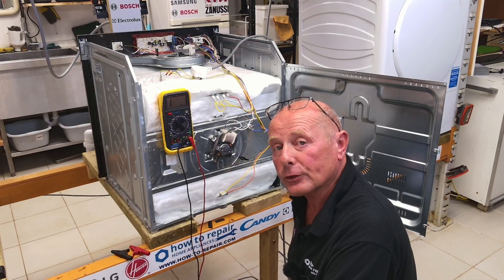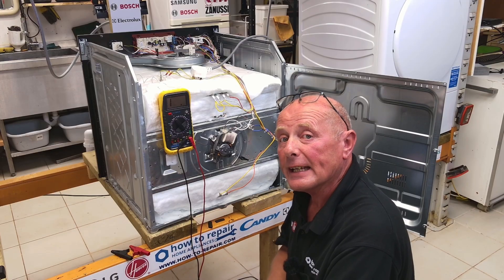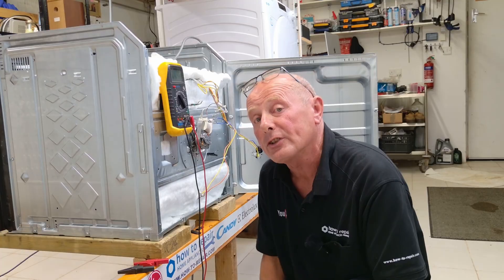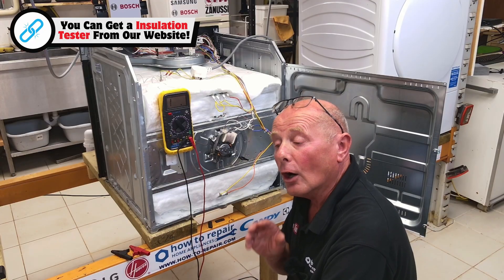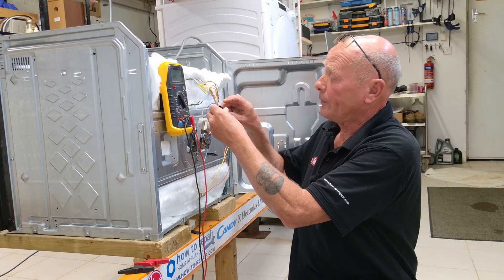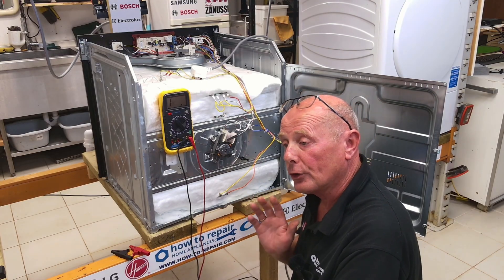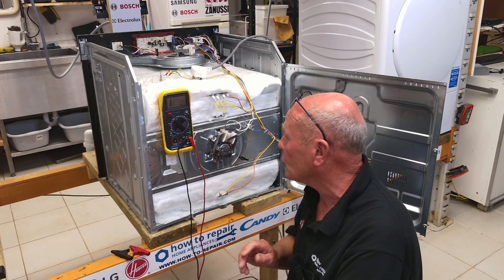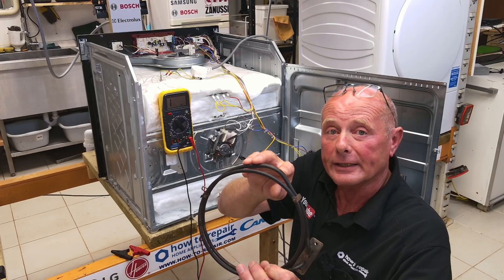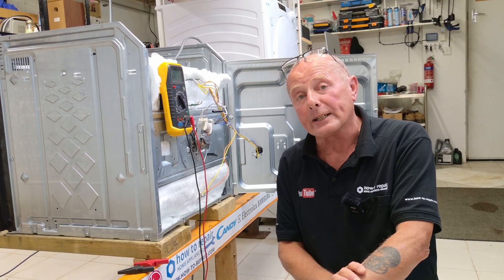Now if your cooker is tripping the electricity, this is a different type of fault. This is earth leakage, and this means electricity is going through to the chassis on the cooker and taking out the RCD on your consumer board. The only way of testing an element correctly is with a very expensive instrument called an insulation tester, sometimes known as a megger. But a cheap way of understanding if your cooker is tripping the electricity because of a fan oven element fault is to actually use some insulation on both of the electrical connections. Make sure they are fully insulated, then put the cooker back into the power supply and test all the functions. If it does not trip the electricity, you can presume that it is a faulty fan oven element. As you will see with this element — if I bring it up to the camera — this element actually blew and opened up the side of the casing, which caused it to trip the RCD or electrical supply. Sometimes it is visible on the element but on other occasions it is not.